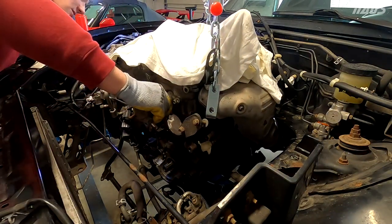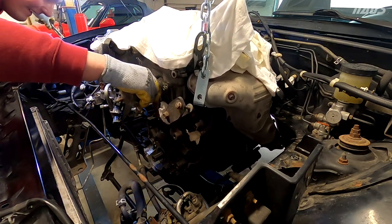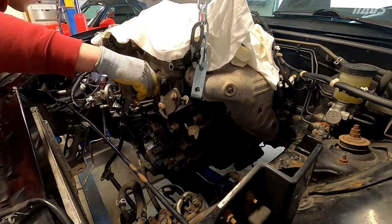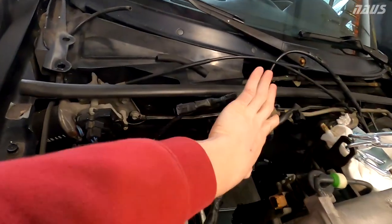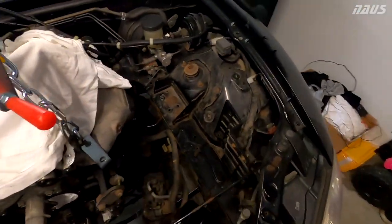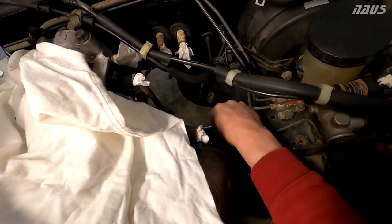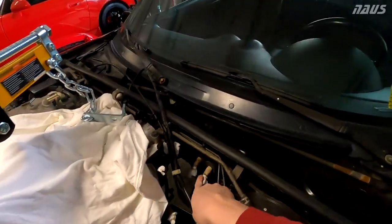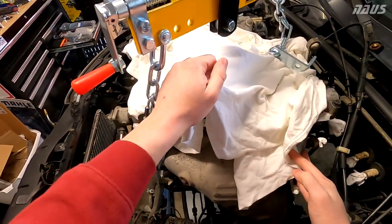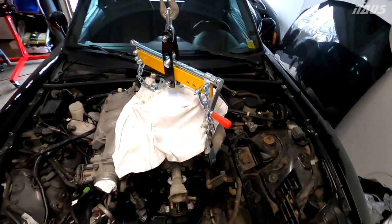Now I'm hitting the steering shaft a little bit, so I'm gonna pump with one hand. I'm gonna switch to the head cam view now. Get the motor floating, we've cleared the harness, everything looks clear back there. Just make sure this exhaust gasket doesn't get hung up and ruined if you plan to reuse it. Get a few more pumps here. I'm gonna go back here, make sure you're clear of these cooling necks too. Looks like we gotta pull it forward a little bit, would probably help. It's not the easiest when you're coming at it from the side.